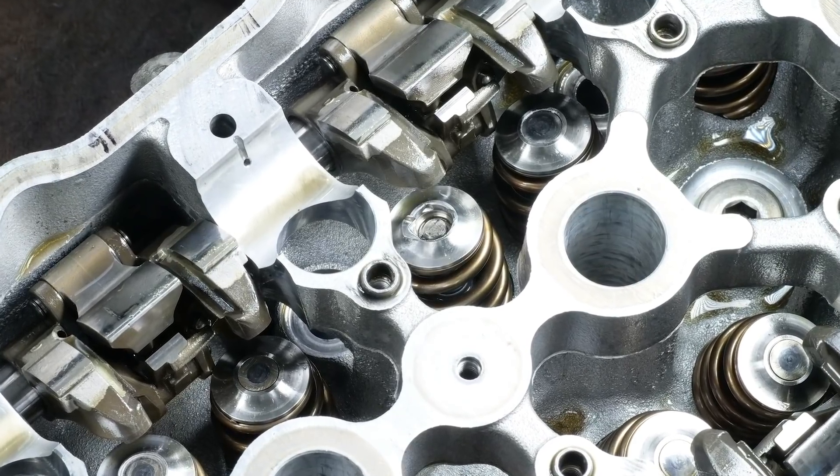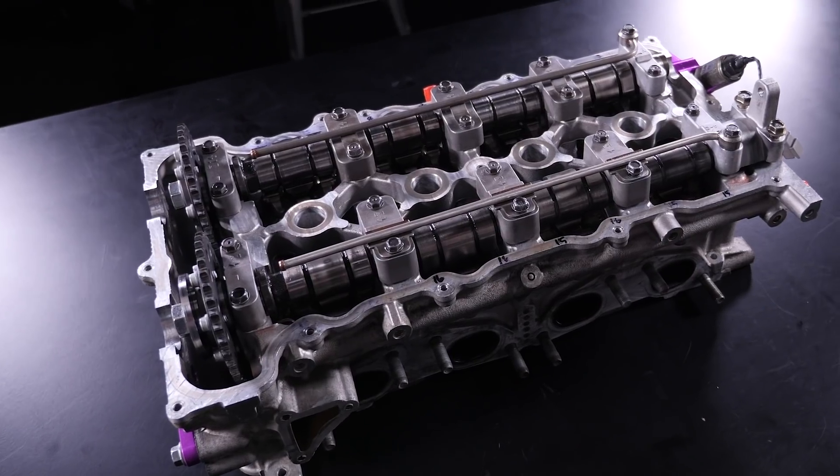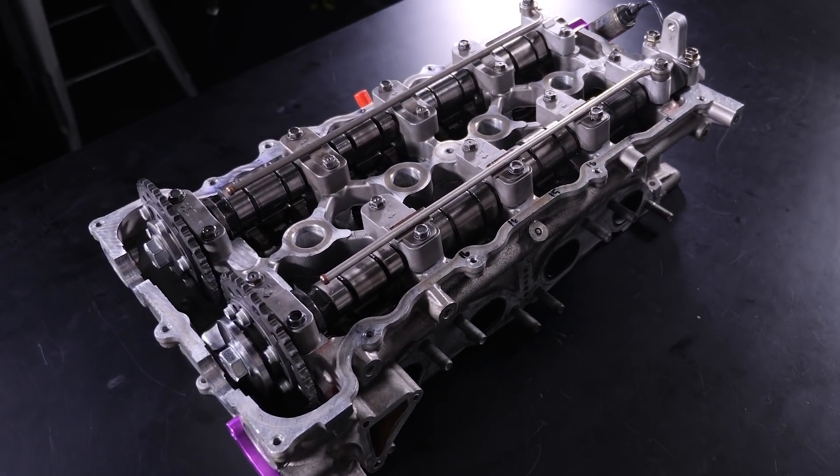We wanted to send the whole head back to our machinist anyway to make sure they could go through it with a fine tooth comb and sort out the issues we'd found. So we pulled the head — everything else in the engine is looking really, really good, so no cause for alarm. In the process of putting the head back together, our machinist also found that the exhaust valve on number two cylinder where the shim had spat out was bent — bent at the top — due to the way the rocker arm was acting against the retainer rather than pushing down on the valve. Nothing too major; the head was just freshened up, the retainer lips were machined down, and the valve lash was set with the cams again.